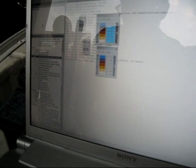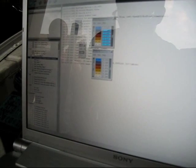The next thing I need is the mass airflow sensor. There are four tables for the mass airflow sensor. I need to go to the 3000GT ROM. There's the size of the mass airflow sensor, something called an adder value which is just an offset in the code, and then two other tables — one is a scaling and one is a smoothing table. There's only one of these tables we really need to worry about; the others are nothing more than calibrations.